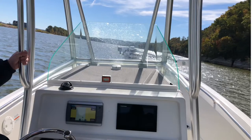One thing I've noticed about this boat is you have to constantly adjust the trim tabs to keep the boat level. It really relies on those trim tabs. Even a 50-pound kid in the boat, if they get up and walk from one side to the other while you're underway, the boat will lay over to that side, or even if the wind changes directions. When the boat lays over like that, it's kind of startling for everybody on board if they're not familiar with a boat like this.